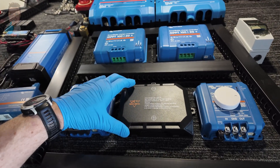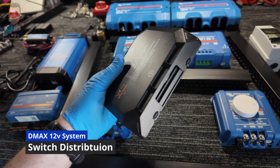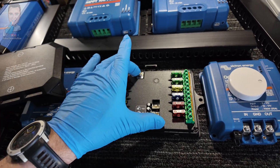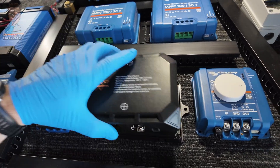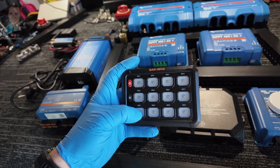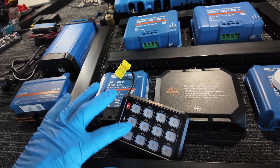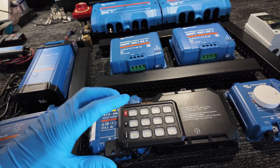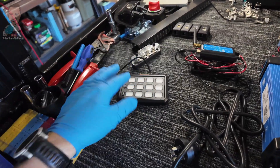From a DC distribution for the smaller stuff, we're running one of these — it's a pretty common off-the-shelf unit, this is a Sanhema one but they're all very similar. It's an integrated switch and relay panel: one positive and negative in, all your fuses already built in and relays as well. It gives us a whole bunch of channels — up to eight — and then the output is one wire and one switch panel, which gives us up to 12 different programmable buttons with little icons. That'll sit over there and give us the ability to switch on things like lights, water pumps, air compressors, and all that sort of good stuff on a physical button.